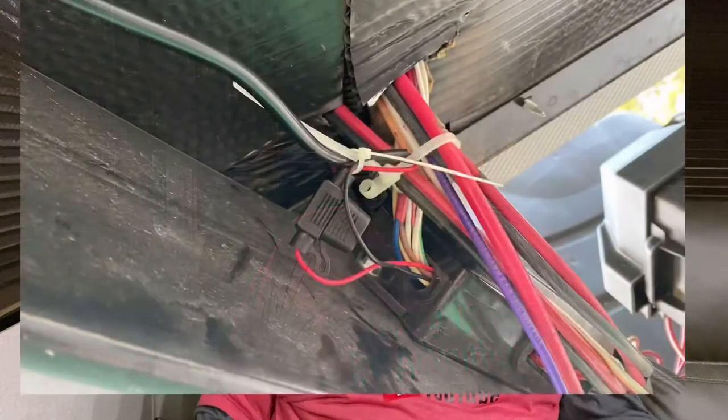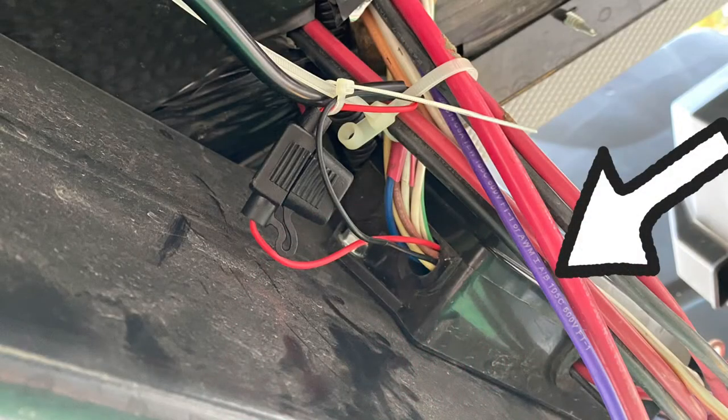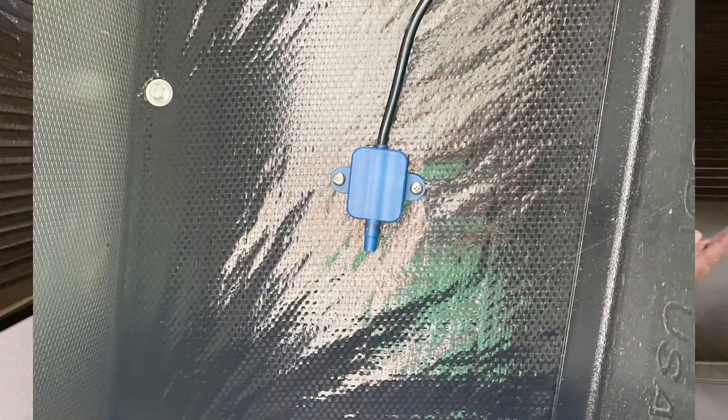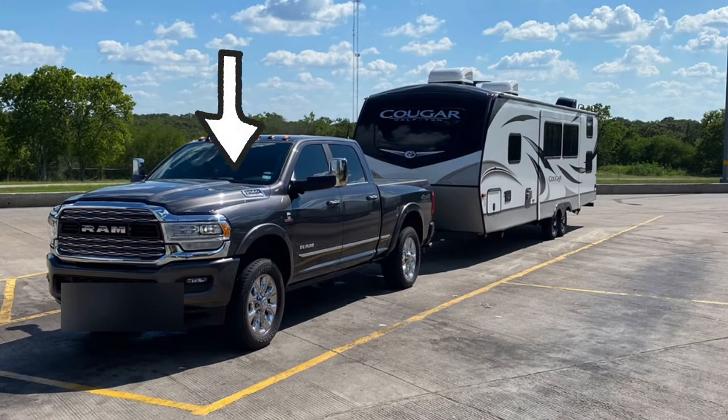I just tied it into my trailer lights, and I know that means the only time it's going to be on is when my trailer lights are on — but my trailer lights are on virtually 100% of the time because that's how I power my observation camera in the back. It was very simple; I just tied it straight into the box right by the tongue, and then I was able to put the relay directly underneath the trailer at the very front, which about splits the difference between the monitor, the relay, and the tire monitors.